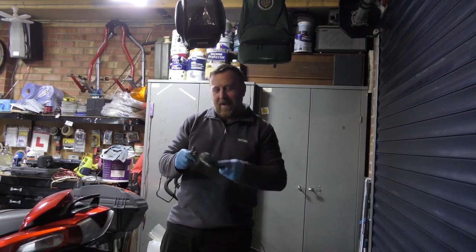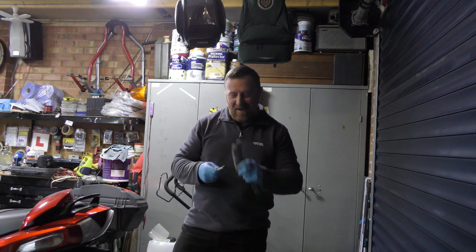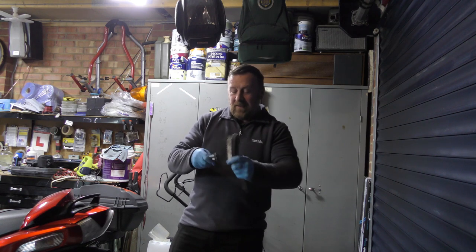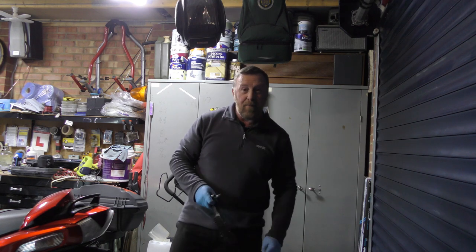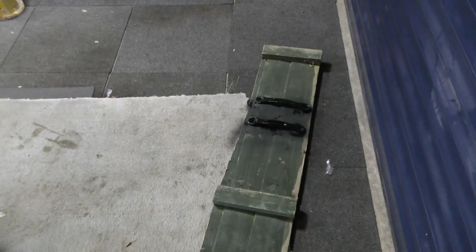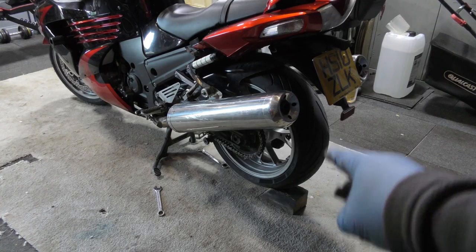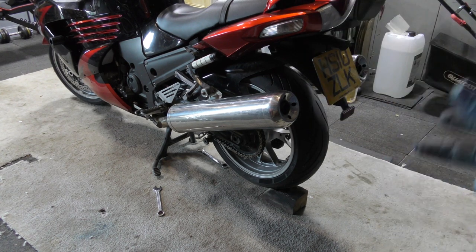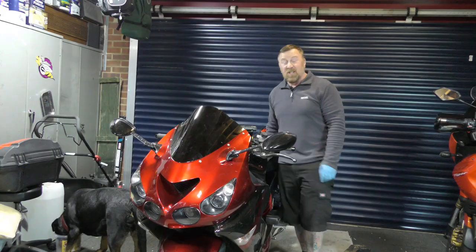I sort of wish I could tell you why I've just sprayed them while I'm cleaning these bolts - I just did it while they're off, quick clean. I'm going to clean these up as well, a bit of Loctite in these ones, spray them all up and put the bolts on. I've cleaned them all up and used the Hammerite spray. Top tip - chock the back wheel as it makes it a lot easier. If it drops down it's just extra weight you don't need, so chock the back wheel before you take them off. Such a simple job.